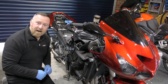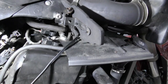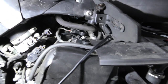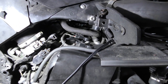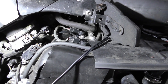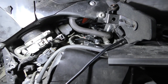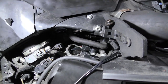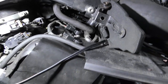We are full. Cleaned nicely back up again. Plugs in — see you the other side. Just a note of caution: you can see the two HT leads. Be careful of any pipes or any wires, okay? Make sure you put them back in the same way they came out. This side was easier because I didn't have to take the coil packs apart, but that pipe there pulled out and made it easier. Just make sure you've not pulled anything when you get these two in.